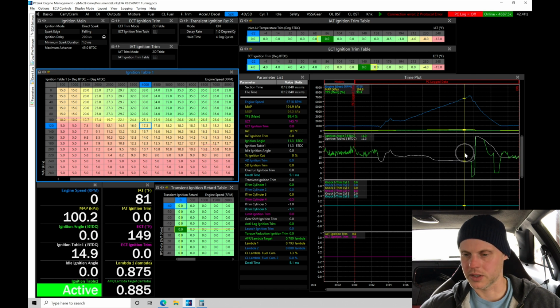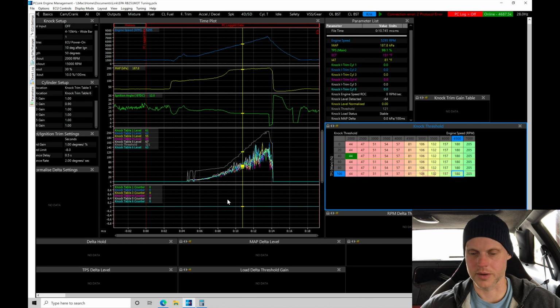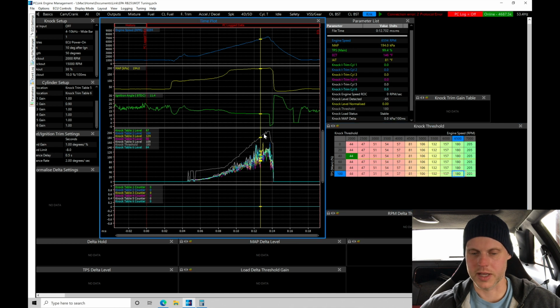So looking at this, I don't see any knock behavior. Looking at that, we can see all these are all the knock ignition trims. No knock behavior there. It was running around 11 degrees of timing. Let's take a look at our actual knock information here. The white line represents the floor, and none of our channels have overstepped that knock floor. So we're looking for the big jumps or big spikes here. Now we do see some spikes going on within the cylinders, but I don't see anything that's a huge overstep. So I think we're good there.